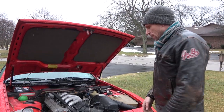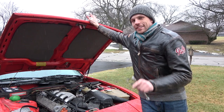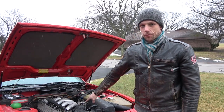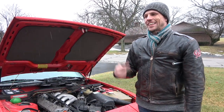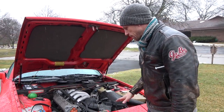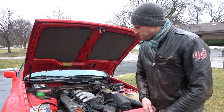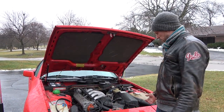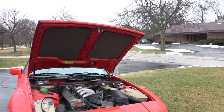Now, what did I screw up? It relates to the timing belts and everything. I didn't want to use any manual — and that's not necessarily a mistake, as long as two things work out: one, the last person who worked on this didn't do something wrong and set it up wrong for you to put it back wrong; and two, something doesn't change that you don't realize in the middle. What happened was, camshaft timing is perfect, all the timing marks are lined up perfectly, it turns over, idles perfect, runs perfect, makes great power — except I had this weird harmonic and I'm like, what the heck? I drive it and I'm like, I don't remember it being this crappy. Turns out one of the balance shafts is 180 degrees off, and I'm going to show you how that happened right now.